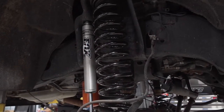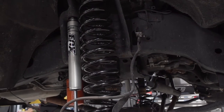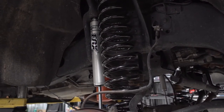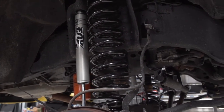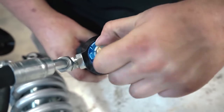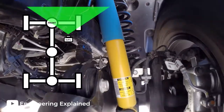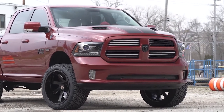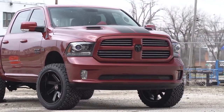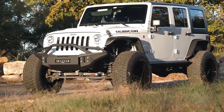Spacer kits are going to be cheaper than the suspension kits, with most costing under $250. Suspension kits replace the front shock and sometimes the entire strut assembly on your truck. This kit will require more assembly than a spacer kit, as you will likely need to assemble the front struts, set the ride height if your kit comes with adjustable shocks, and preload your springs. However, suspension kits can increase your suspension travel and improve ride quality, especially if you're replacing old and worn out shocks. Suspension kits are more expensive, with most ranging from $500 to $1,000, though some high-end kits can cost up to $2,000.